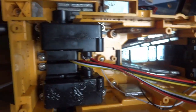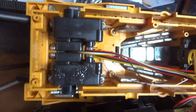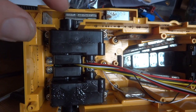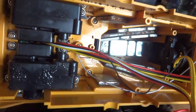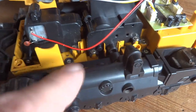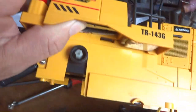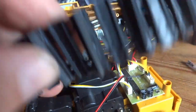I've finished fitting all the tyre weights. I think there's probably about three to four hundred grams in there — it doesn't sound a lot, but it makes a considerable difference when you pick the thing up. It's always a danger that you've put too much in and overwhelm the travel motors, since it'll put a lot more strain on them moving the dozer around with a third to a half more weight. Anyway, it's a bit of trial and error. There's a small amount in these compartments but not a great deal of space. I'll need to trim a bit off those track arches to accommodate the extra rubber bits on the tracks.